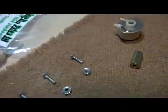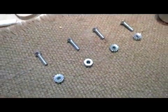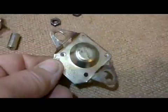You can see it's just an electromagnet. There are the 8-32 screws and lock nuts that we'll use to replace the cover, which we drilled out — drilling out the aluminum rivets.